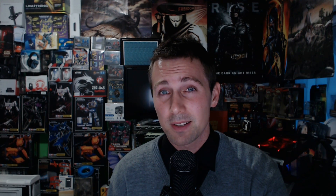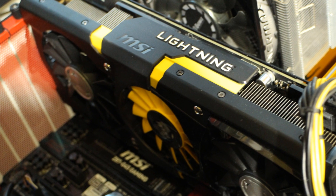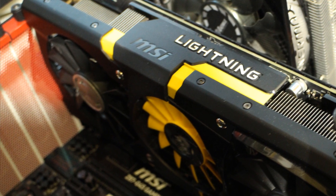First off, we had the graphics card, which was the most important part besides the CPUs themselves. This is the GTX 780 Lightning Edition. I didn't just leave it at stock settings — I pushed it to the max, putting +205 on the core and +202 on the memory, and also gave it a 49 millivolt overvolt. These settings were my sweet spot where my card likes to run, and it gets a lot better frame rates over a standard GTX 780.